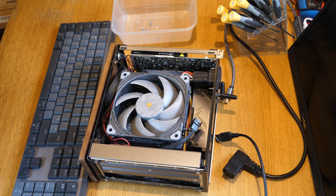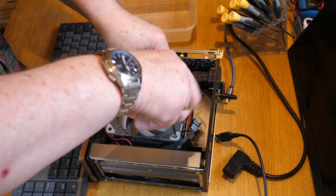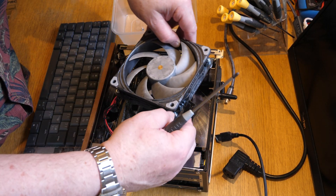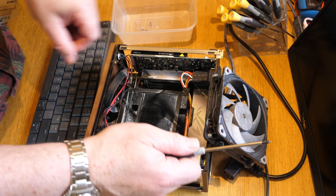Now, if you're running 105W Eco mode, I've never had a problem with the power supply cutting out. However, if you don't set 105W Eco mode and let it just do whatever it wants, it will cut out. Don't ask me how I know this.